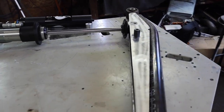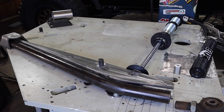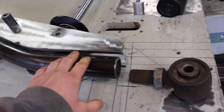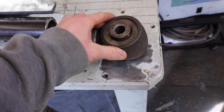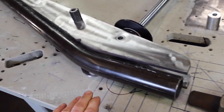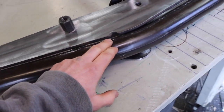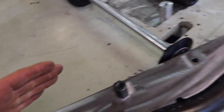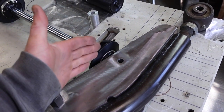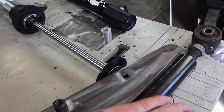We're using a different suspension design in the rear of the Trooper — trailing arm. The primary difference is where the coilover is mounted. We have a coilover mounted on the arm instead of on the axle. The basic layout: we have a Johnny joint — like a heim joint with polyurethane on either side. Then a double adjuster, and on the other end a bushing. Here's our bracket that's going to be welded on the frame. The reason this is bent is to allow the coilover to mount below the center line. If it were a straight tube with the coilover mounted above that line it would want to roll — kick itself off the top — but by bending it we lower that mounting point down, making it stable.